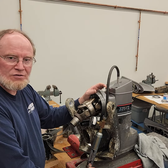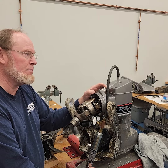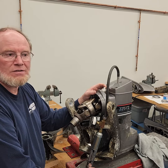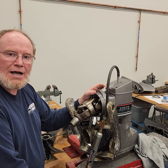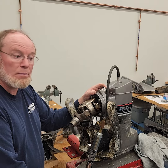I vacuum tested drives when I was younger, but around 1987 to 1989 Mercruiser changed the seal design and told us not to vacuum test the drives anymore. That's when I pretty much stopped doing it, and I have not had any drive failures since — as long as it passes a pressure test.